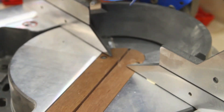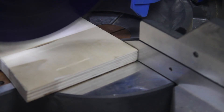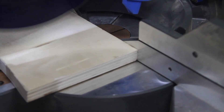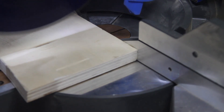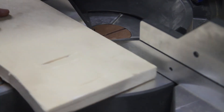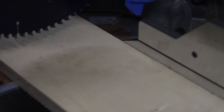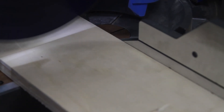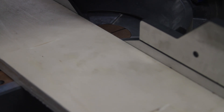Let's take a look at the shadow line and see what we have. It does create a shadow line — it's pretty good, I was hoping for a little better. The LED closest to the front side is a little mis-aimed, and I played with the aim a little bit and it got maybe slightly better. What I think I might do is add either two more LEDs — one more on each side — or maybe just add a third right in the middle. I'm pretty sure I'm not done with this project and I want to see if I can get two more LEDs on each side and brighten up that shadow.